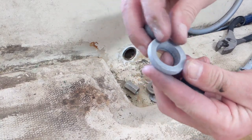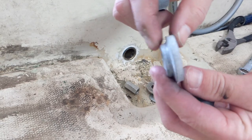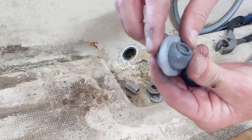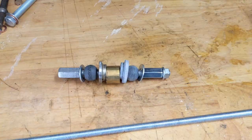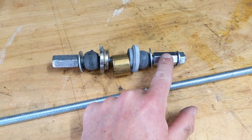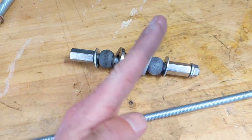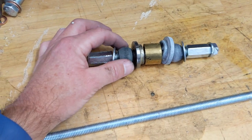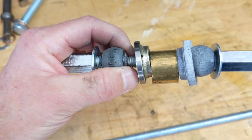The top part there cracked or deformed — we had a washer on the outside and the washer actually pulled in close enough to where it was hitting the top, so while it didn't fully fail it's a little worse for wear. In the end, I used the longer rod and this is how it worked out: on the outside of the boat I had the brass with the two 3D printed pieces, which you definitely need with that steep stern incline. The ball deformed under pressure and you can see it pushed up into the metal, so if I were doing this every day I'd just have these made in steel.